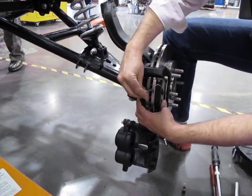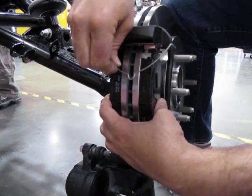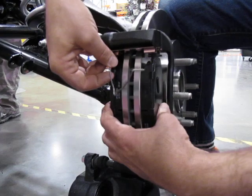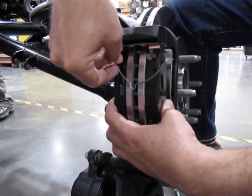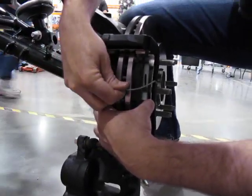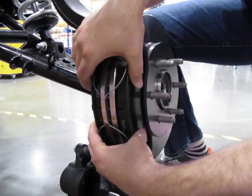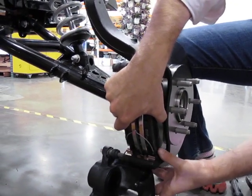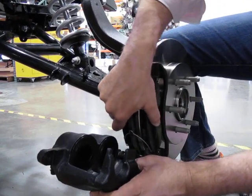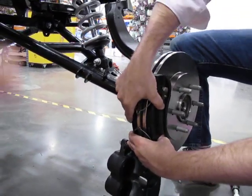Hold the top, and you want the little curvature in the spreader to face down. Slip it in, slip it in — now you can see I have the two spreaders sprung into the holes on both sides. The last piece, as I squeeze them, is taking the caliper with the guide pin pulled all the way in, and sliding the caliper back over the brake pads.